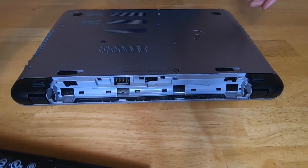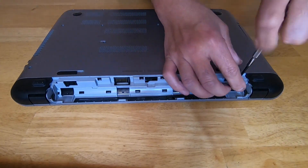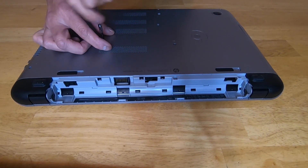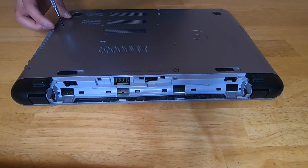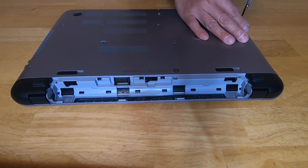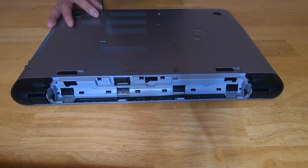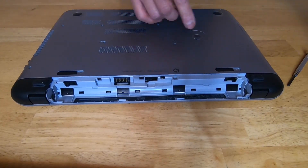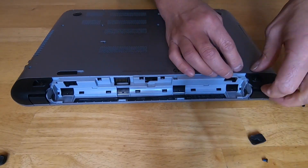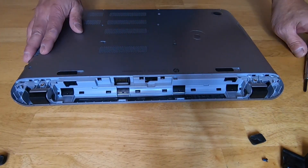The first thing we have to do is remove the battery — make sure you have unlocked it, then pop it out. Then we proceed to take out the 15 screws on the back. They're all the same size, so you can set them aside in a pile and reuse them in any other spot on the back cover. After taking all those screws, there are also a couple of screws hidden under the rubber feet, and you have to remove the rubber feet — they're retained by further screws.